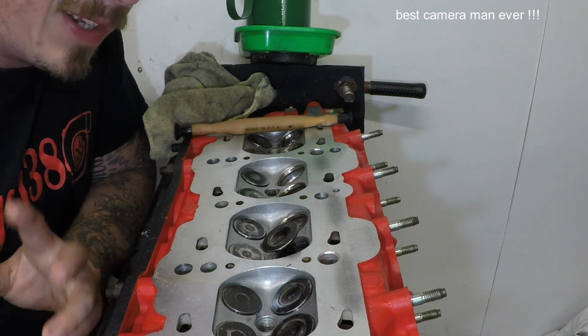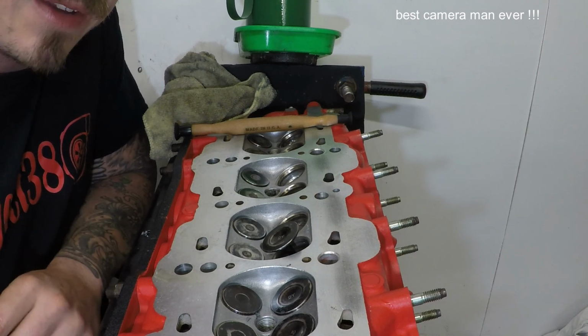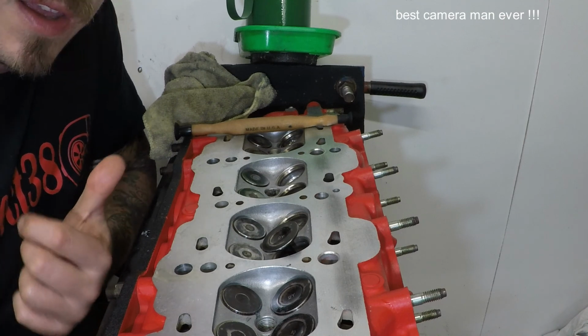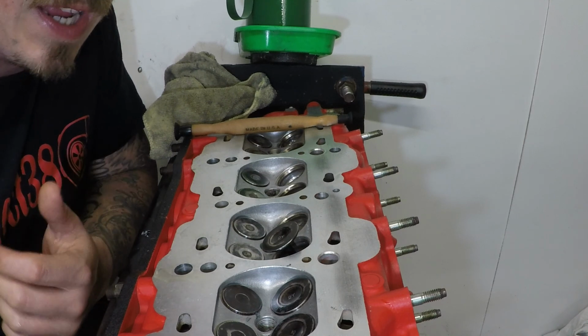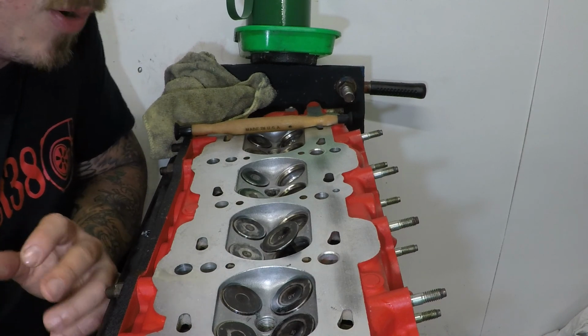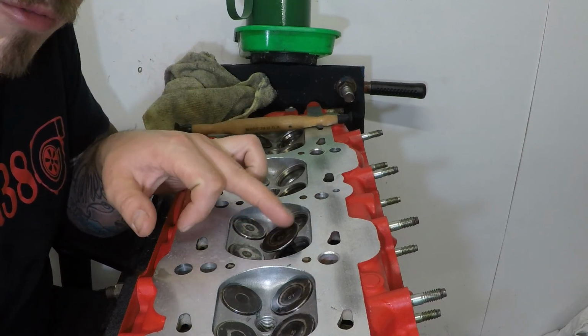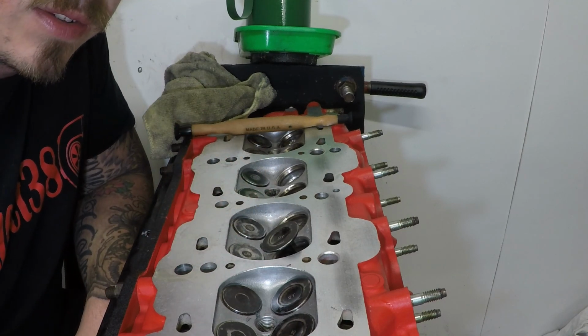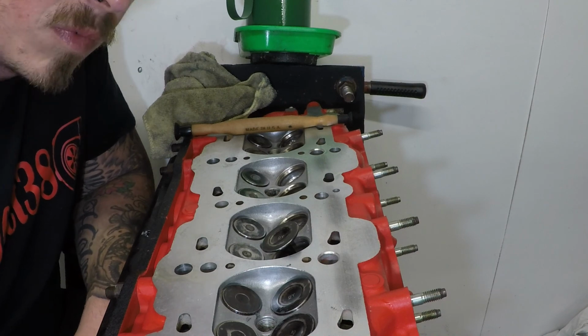So I'm having a bit of a hard time getting the intake valves to stick to the valve grinding stick. I've never actually used this one before. I did have a larger stick before with a larger suction cup, which I think helped, as there's quite a recess in the intake domes. So the internet says try hot glue. Let's give it a go.